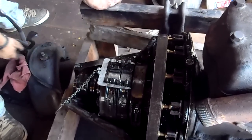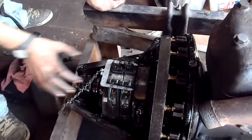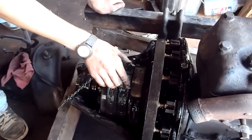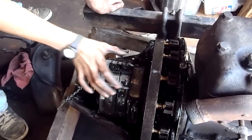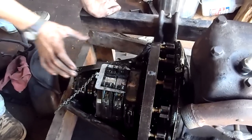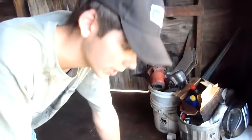And then when you lift that out, there's a cam and an arm, and it pushes that clutch out. Basically the whole rotating assembly spins — so it's a direct drive. Then you've got your reverse here, and you have a lever where you push the pedal and hold the transmission in what they call neutral, sort of an in-between. Then you can squeeze the reverse pedal and it'll go in reverse. And then you've got the brake — to come to a complete stop, you put it in neutral and then squeeze the brake.